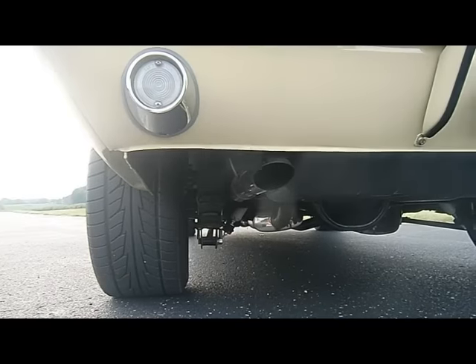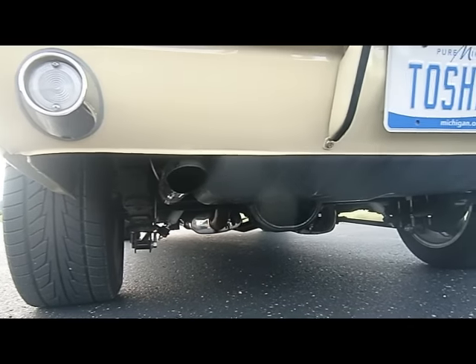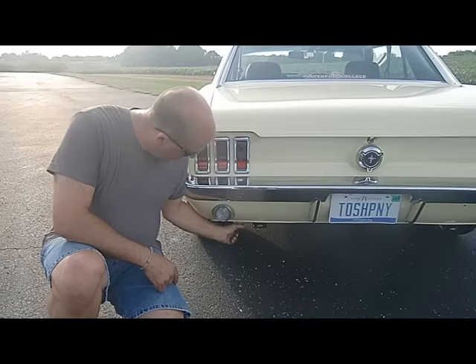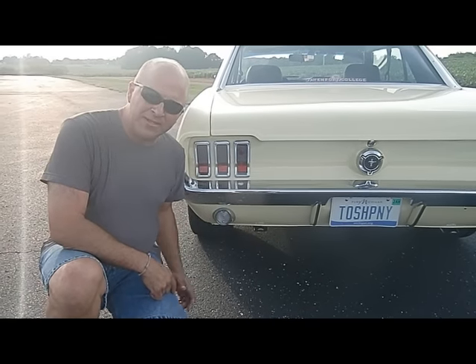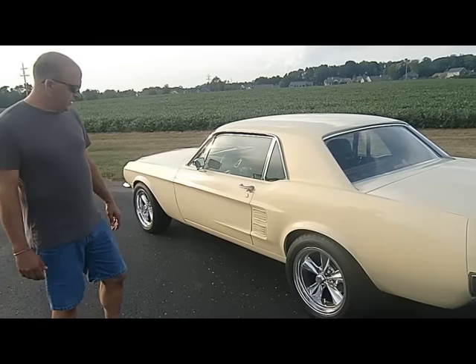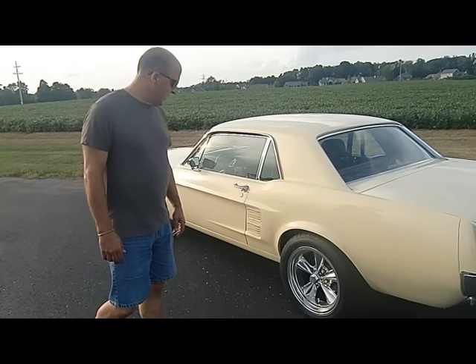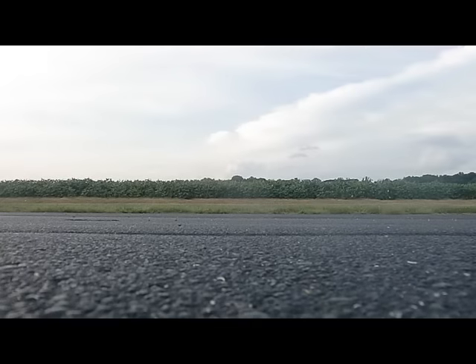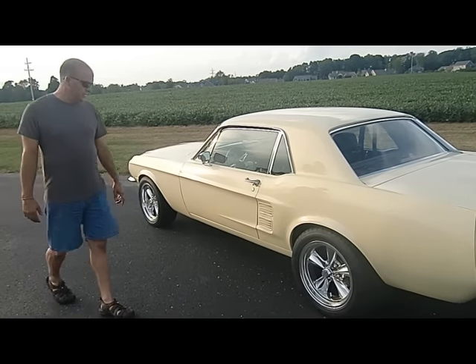New chrome on the back. I spent a lot of time on the exhaust. I picked a Magnaflow 2.5 inch stainless with a cross pipe, and I like how they just kind of peek out below the rear valance. Looks really sleek and clean. We picked 17-inch American Racing rims on Nitto tires — 255s in the rear, 245s in the front. Gave it a little bit of a stance.